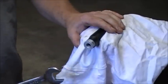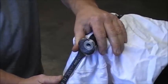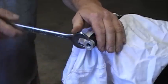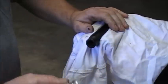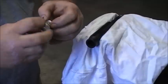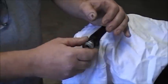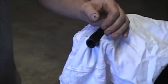I've mounted the hydraulic locking device and I'm just going to show you how easy it is to remove it. All that's required to get this out is a small turn clockwise as if you're going to tighten it up until you get a bit of friction with it — and then it will just go. Once it's gone that way, you can just turn it back the other way and it backs out. It's really that easy. When you put these back in, if you change your bike back to standard, literally a couple of drops of super glue — don't have to smear it completely around, just a few drops and then put it back in exactly the same way. We've tested this — I've been using a bike for a while that's had these put back in and there's been no problem. They're stronger in there with a few drops of super glue when they go back in than they are from the factory.